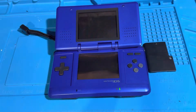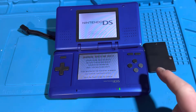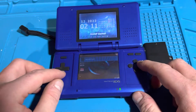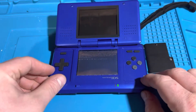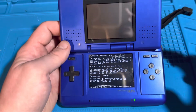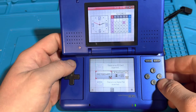A bonus clip for this video. The reason I have the battery cover off this DS is that I am going to be installing the normal version of FlashMe, which removes the health and safety screen. As you can see, I currently have installed the stealth variant of FlashMe, which retains the health and safety screen. So I am going to go to FlashMe — specifically V8A FlashMe, the normal version and not the stealth version — and I will be flashing this DS off camera so that the next time I turn it on, the health and safety screen is removed. Now that I have installed the normal version of FlashMe, when I turn this DS on, I have successfully removed the health and safety screen.